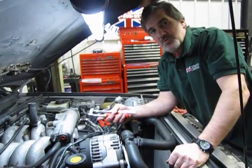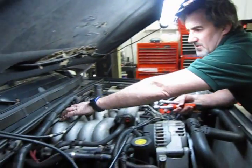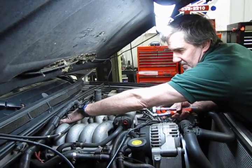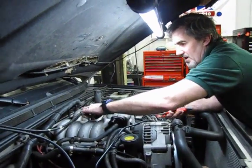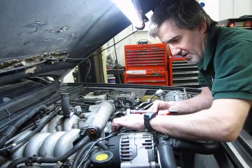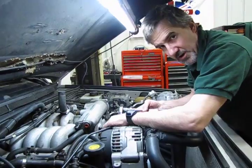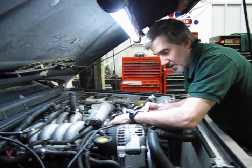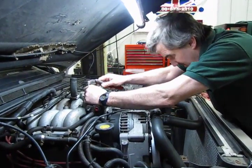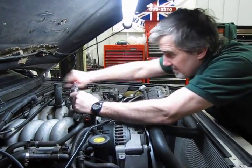Alright, we've taken those two small bolts for the top of the coil support out, and now we're just going to remove the one 10mm head bolt in the back that's dead center in the middle, just from the back side of the intake. You've got 4 long bolts up top, and then your 6th is definitely up front, and like I said, you can see it right through that opening. If you're not sure you're getting on that bolt when you run your socket down in there, take a flashlight and run it through the front, and you'll be able to see it quite easily. So we'll just drop it in, we'll take those 6 bolts out.